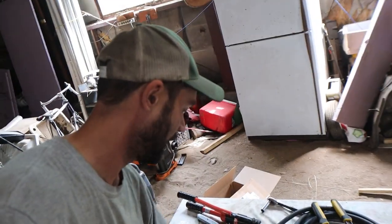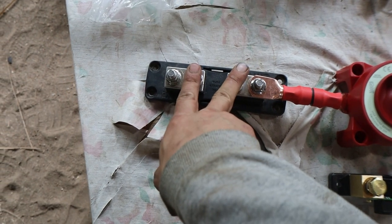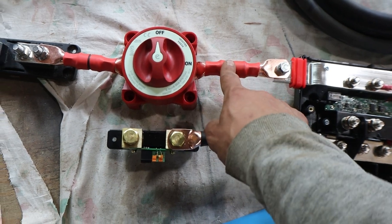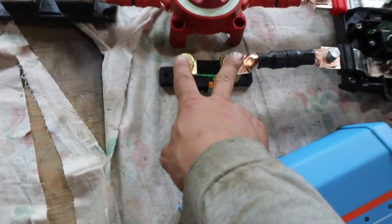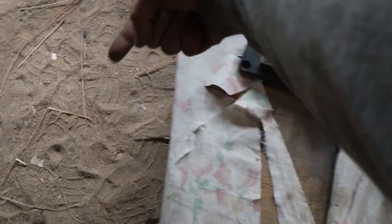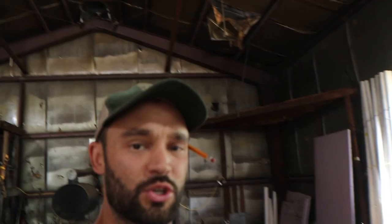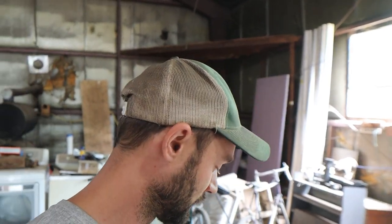We got the link system to the batteries connected. You're going to see it all wired into the bus really quickly. We've got our mega fuse holder here where a 400-amp fuse is going to go. We've got our main system on/off into our actual links. I chose to do these with 4-aught lugs and 4-aught cable — you could also use a copper bus bar if you wanted, but I'm using these. Then we've got our negative side coming out to our BMV 712, which will go to the negative on the battery terminal. The positive will go to the positive on the battery terminal, and then we've got our entire battery-to-links set up. All of our distribution and stuff is going to come out of this location. This is part number one — let's just get the links to battery done, then tighten all these bolts, physically install it inside of the bus, and get the batteries wired in and linked.